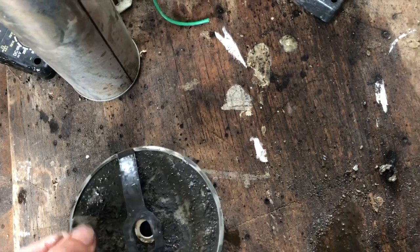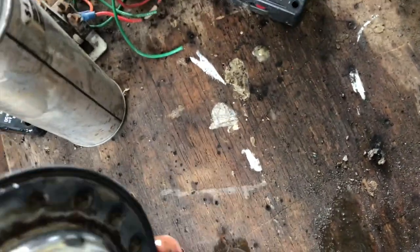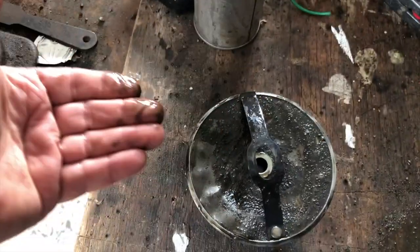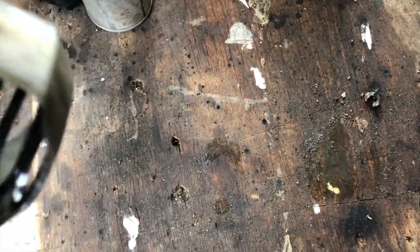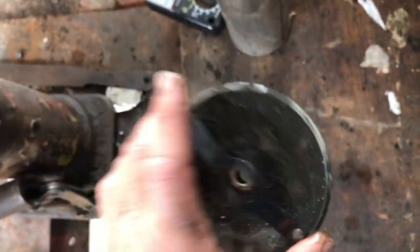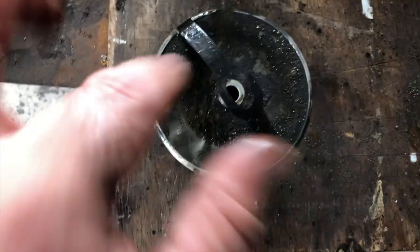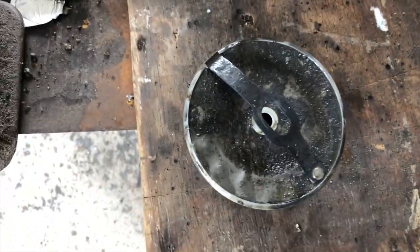The screen is actually in pretty poor shape. I'm going to clean this screen up. I'm going to blow it with air across it this way, not directly into it — I'll just be forcing everything into the screen. I could probably pry that screen out, but it's not supposed to come out. You can see where it's crimped around the edges. I wish it was removable so I could get to it from the back side, but the design is kind of bad that way. So I'm going to blow it out and maybe flush it again with brake cleaner first, to get the screen nice and clean without pushing everything into the valve assembly.